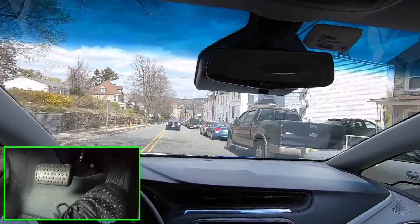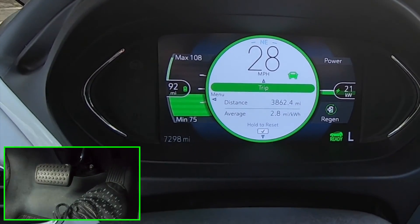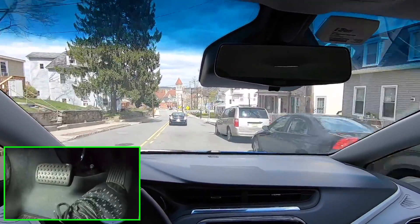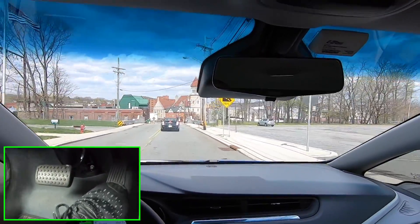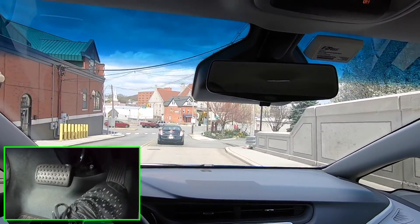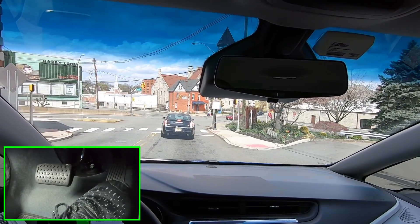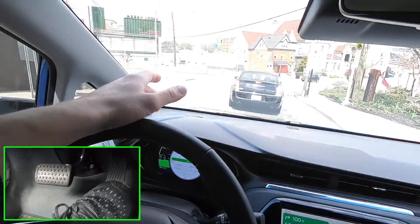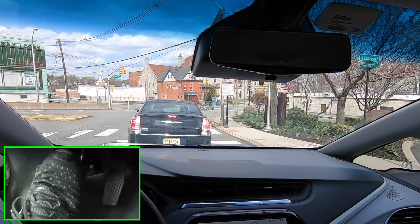Got a nice downhill here going into Dover. You can see on the right-hand side of the screen we're regenerating power — we're at 13 kilowatts, climbing as we go down this hill. I have not hit the brake yet; I'm maintaining 25-26 miles an hour with just a slight bit of pressure on the accelerator pedal. Approaching an intersection now — I'm going to stop a little further back to see if holding the paddle is enough. It's still rolling, so I may actually have to break the premise of this video and hit the brake, otherwise I'll roll into the car ahead on this downhill — and I do have to hit the brake.